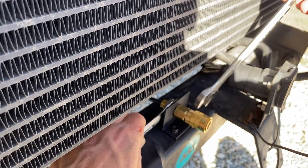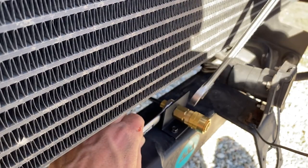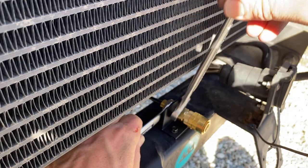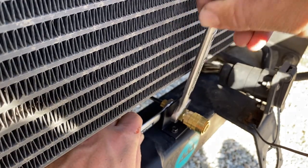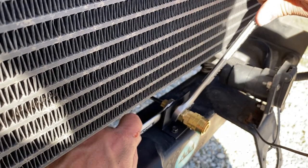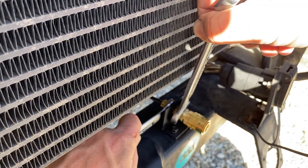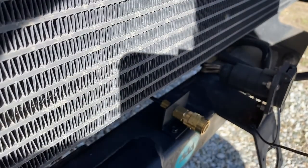Staying for testing, which means I'm going to have to go under the RV when the engine's running and spray down all the fittings I worked on with a soap solution, while somebody else presses the brake pedal to put pressure to those. This goes nice and tight. This part, until testing, is done.